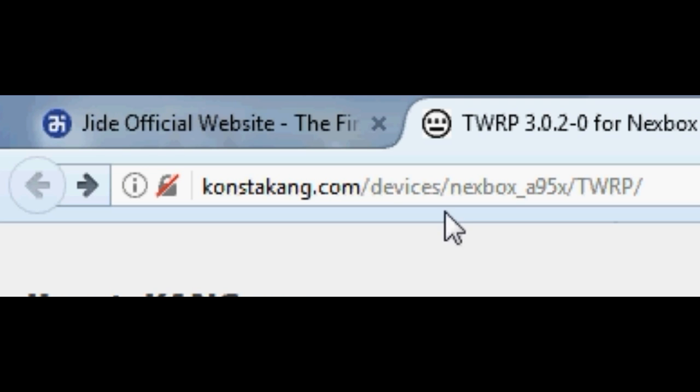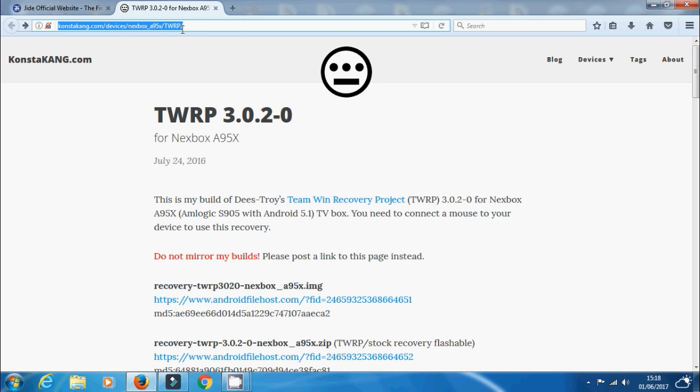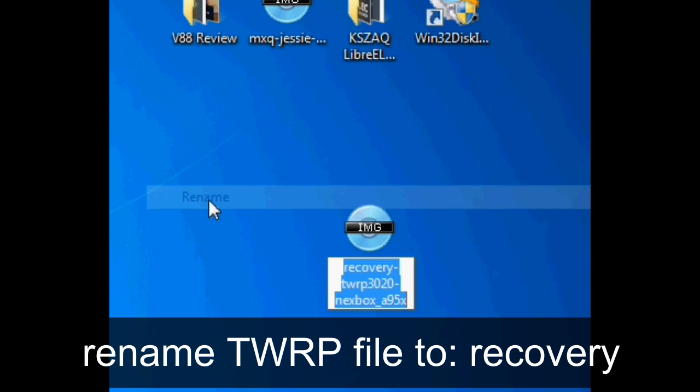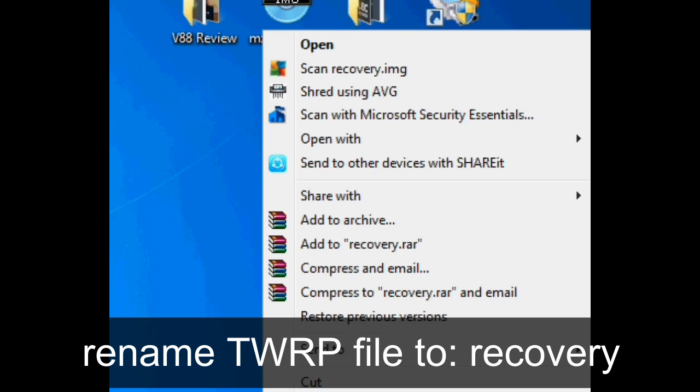Next thing you need to do is go over to grab TWRP. I'll leave the links again in the description where to get this, and the link for TWRP is just here. Next, we need to rename that recovery image file to just recovery as shown, and it will display as a recovery.image file when you check the properties as shown here.